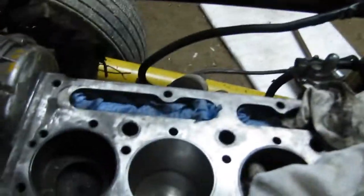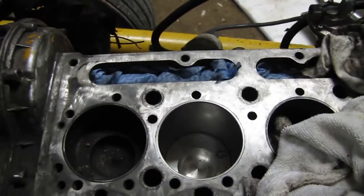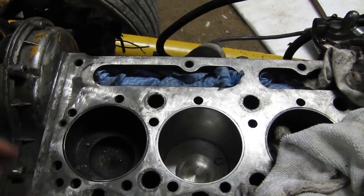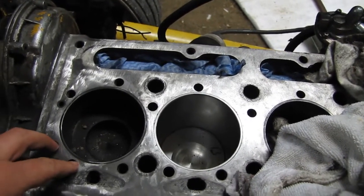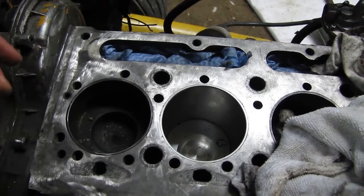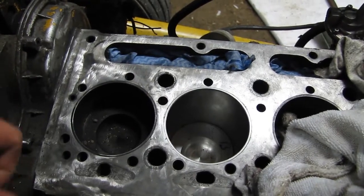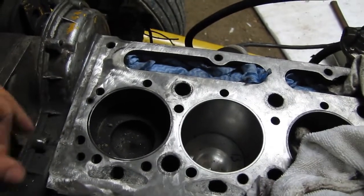And the studs themselves, it's viable for you to put oil on them. You just put a little bit of oil on both the threads, and just put some that go in here. These don't have to be torqued, just tight, like snug, and then you're torquing after on the nut, and you can oil both sides just a little bit.